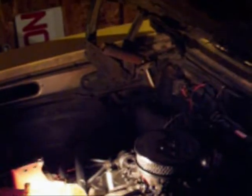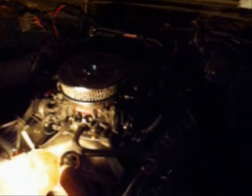But I was talking earlier today about vacuum lines and what you need on a Chevy small block. Given that you don't have special pollution control or fuel injection and you have your standard carburetor, there's only a couple lines that you really need off of your carburetor. The rest of them should be plugged if you're not going to use them.